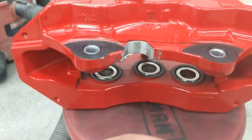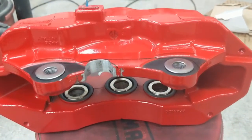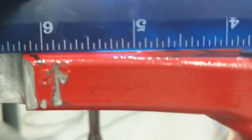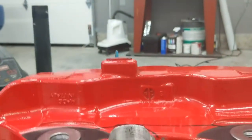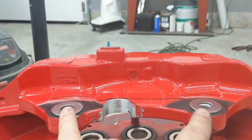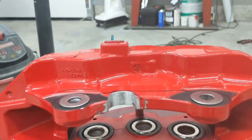I've got some really thin stainless washers — I have exactly four and that's how many I need. I'm going to run these at the contact points so the ruler doesn't rock when placed on them. It leaves a tiny gap, less than a millimeter, that you can't even see on camera. When the bolts clamp the bracket, there's no hollow spot where the bolts are going — I don't want extra stress on those ears trying to close that gap. I'll contact Peter about this, but I'm doing it because I think it'll work better.